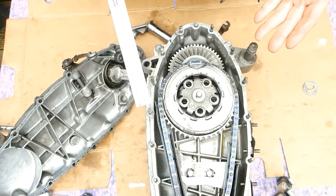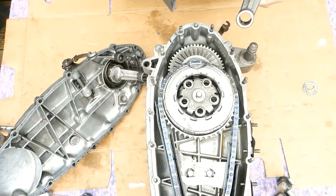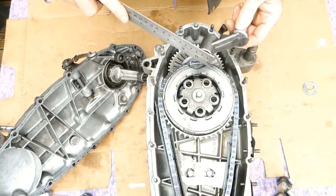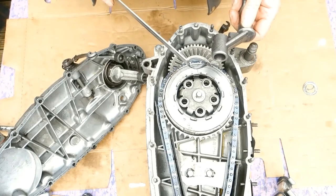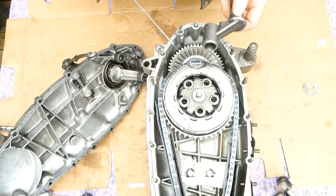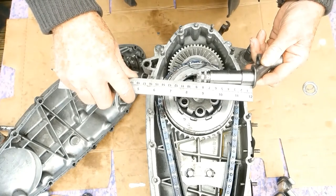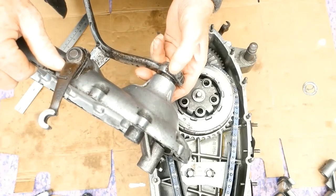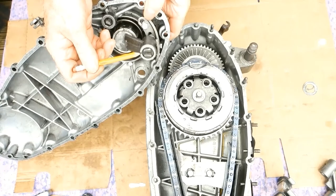To overcome the issue would require a 1.5mm gasket. The teeth were sitting approximately 1.5mm below the top of the rim. So that would mean: upward piston travel — 1.5mm to reach the top of the rim, 1.5mm to accommodate the gasket, 2mm to mesh with the cogs — 5mm of upward travel on the piston, 30mm of travel on the kickstart. I bought a new shaft, 66.5mm long. With the new shaft I got a 1.25mm flat shim and the circlip. This is also 2mm lower in height. The teeth are protruding slightly above the rim.